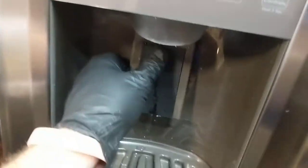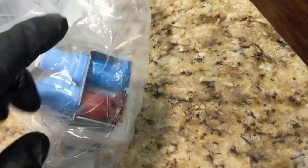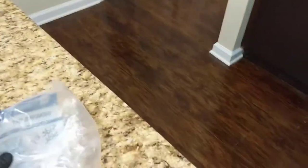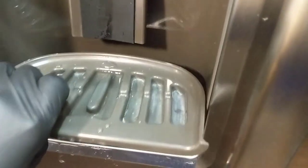The problem is going to be the dual water inlet valve, which is right here. One of these solenoids goes to the ice maker and the other one to the water dispenser on the refrigerator. The ice maker back here has no issues — we're getting ice made — but just this leaking out here. I'm going to pull this pan out; it's full of water underneath there as well, and we'll get that cleaned up.